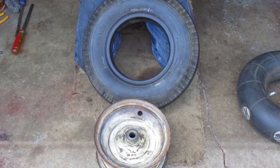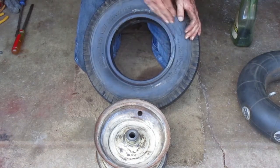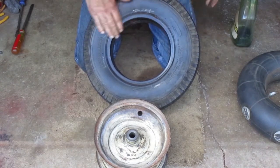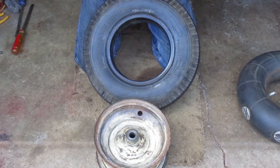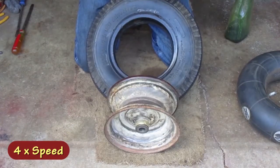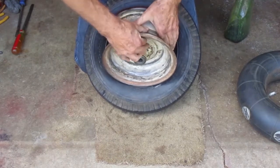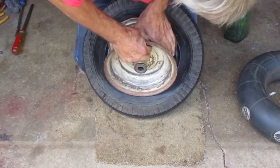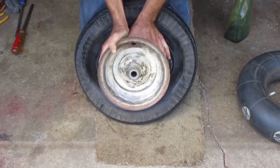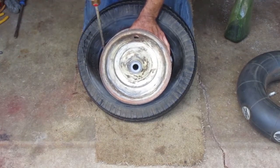When I'm starting out, I don't put the tire over the rim, I put the rim inside of the tire. First, I used some old dishwashing soap for lubrication. I start the rim towards the middle of the tire and use a scooping motion to get the leading edge of the rim wedged in there. Then use a big screwdriver to hook the tire over the rim.